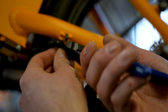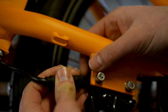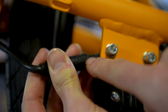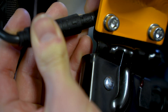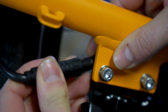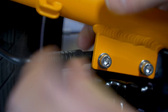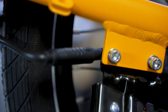For the purpose of this video I'm just going to snip this cable tie so I can show you the connection. You'll see on this block here — which is the connection point — two black arrows. The first thing to look out for is that they are lined up with each other and as close as they can be to meeting. They're never going to exactly meet because they don't start at the same point, but as long as they're pushed in together that should be fine. What you want to avoid is a big gap between the two arrows — that ensures the motor is running well and communicating with the display.